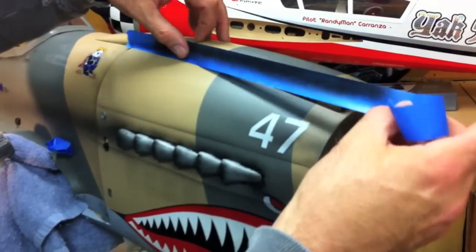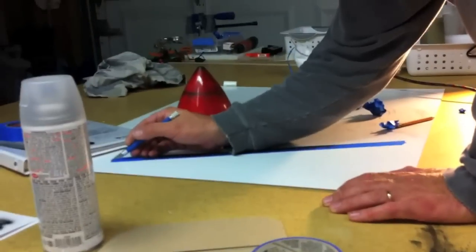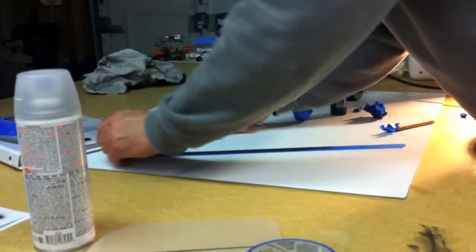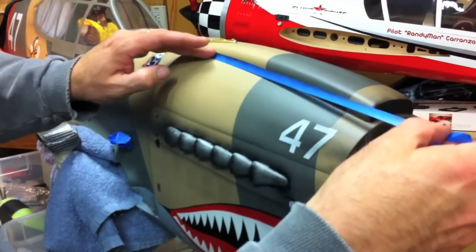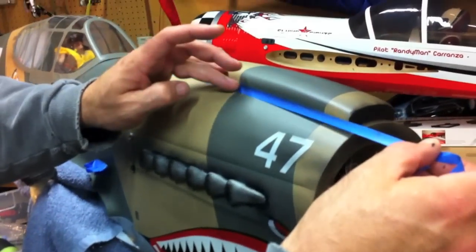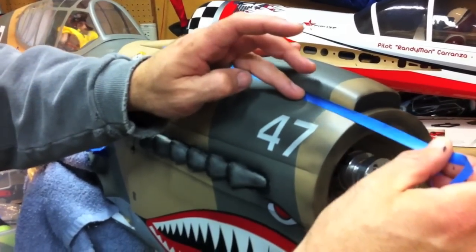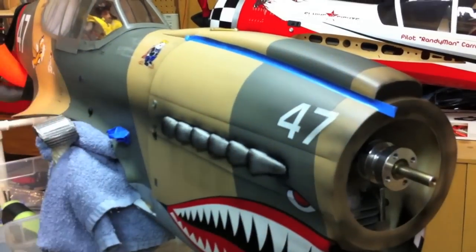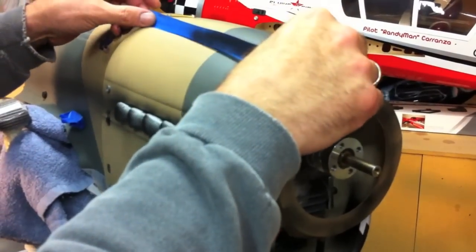Same thing in here. Now this is a little trickier because we've got a little angle going here, so I'm going to show you one of the tricks I like to use. You just put it down on a piece of cardboard or anything and go ahead and thin your tape out — just make it a nice thin piece. Thin tape, narrow, makes it very easy to get around edges. Now I can get into that area I need to get into. It just bends and conforms really nicely to that curve — it's not folding on itself, and it makes it very simple. With that paint deadener and because of where I've already painted, this tape not being very strong is actually very helpful right now, because I'm not pulling up paint that I've just done.